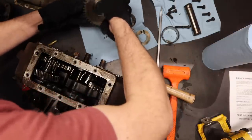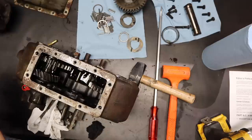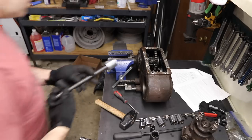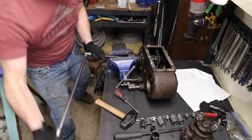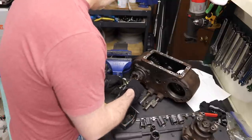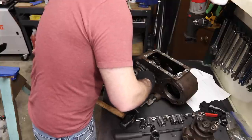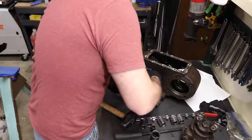So there are three washers and 48 needle bearings — that's what it said. Remove the front output yoke nut, holding the yoke with a large pipe wrench or bench vise — I can do that. This is a one and one-eighth. And honestly, who wouldn't replace the seal right now? I appreciate that the instructions are thorough, but come on.